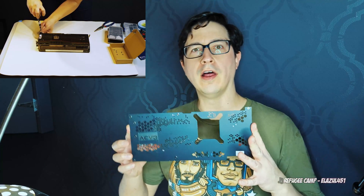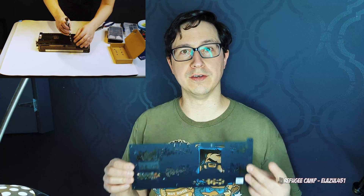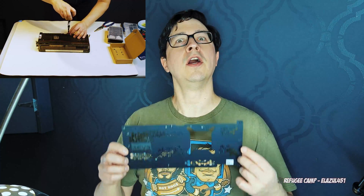As has been noted in other videos on this card, the backplate does not have any transfer material on it whatsoever. On my first test, I'm not going to be putting any thermal pads on this, but I will be putting some on subsequent tests so we can compare those temps. Always remember when taking off a bracket — whether it be for a CPU or a GPU — take it off at four points in a diamond pattern, or a pentagram pattern if it's got multiple brackets, just to ensure that you're relieving tension in a circular fashion from around the GPU or CPU die.